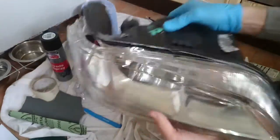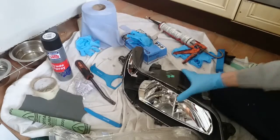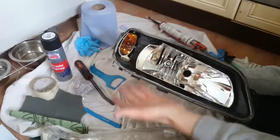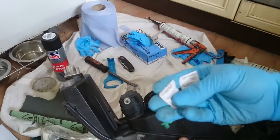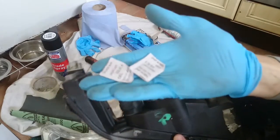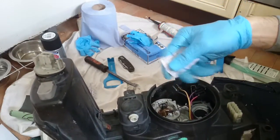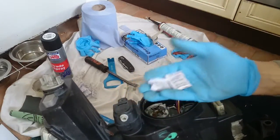Then you can fit it back to your car. Top tip: the reason you want to put so much silicone around there is so it's all sealed up and you don't get those fogged up lenses - you know, the fog inside there. There's another trick to it as well: get some of these silica gel packets - you see them in clothing and boxes of electrical goods. They soak up moisture. Put a bit of masking tape in the back of your headlight and stick a couple inside, tucked down somewhere but not near the bulb connections, so they don't rattle around. They'll help with fogging and soak up all the moisture. Piggy top tip!